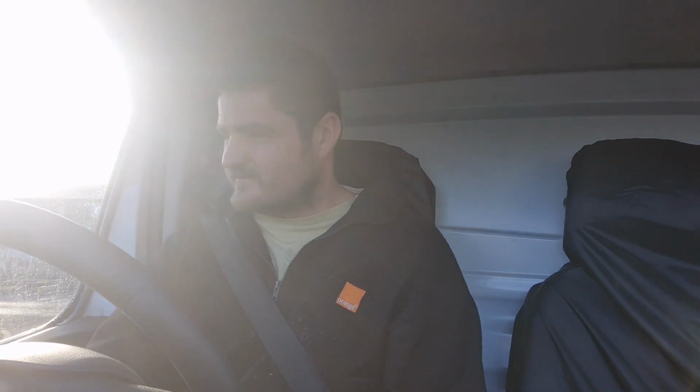Right, back to present me. Are we all good? So, yeah. You'd think I would learn by now, the amount of cars and things that I've patched up and fixed up over the years. You'd think I would have learned a lesson by now that you physically cannot patch rust. The only way you can get rid of rust or do a proper repair is to physically cut it out and start again. Hence what we've had to do here. So as you've seen in the video, I tried to patch the hole that I thought could have been salvageable metal.